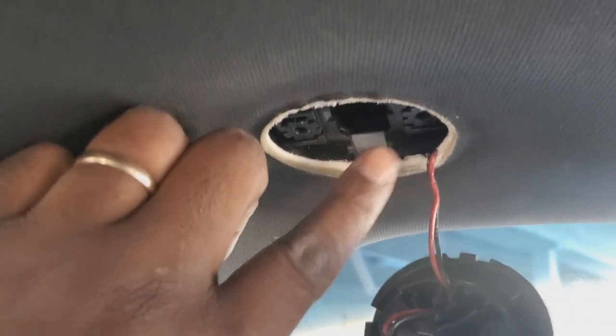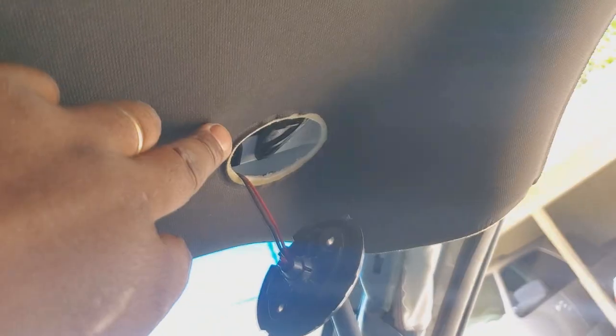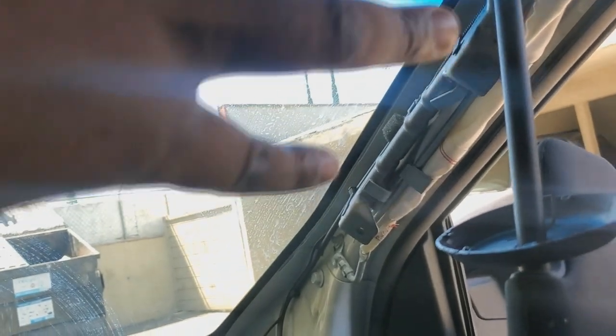And of course what you got to do is release the 2 screws here for your visor. The one here for the visor clip, on the other side for the visor clip, 2 screws there for the visor. You have 2 9/32 for your handle. And then you want to pull out your sides. You want to pull back the rubber here out of the pocket.